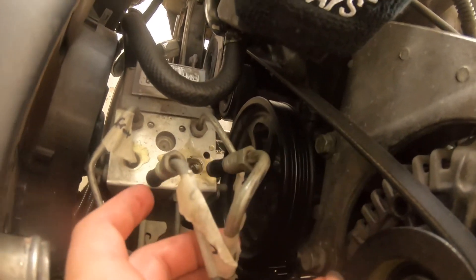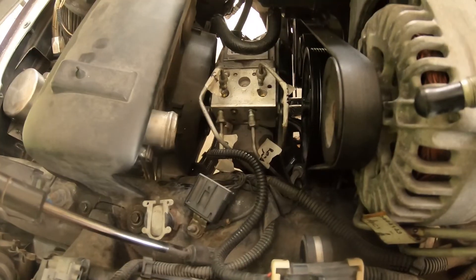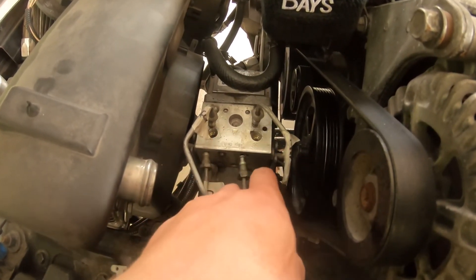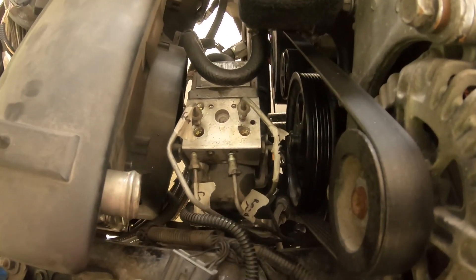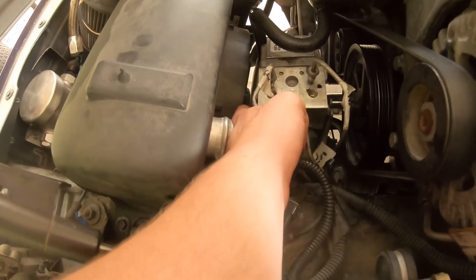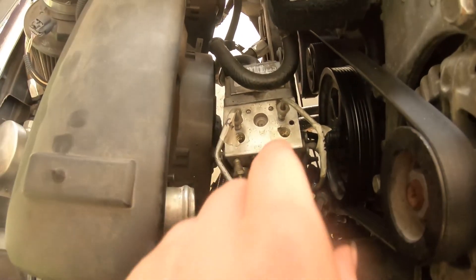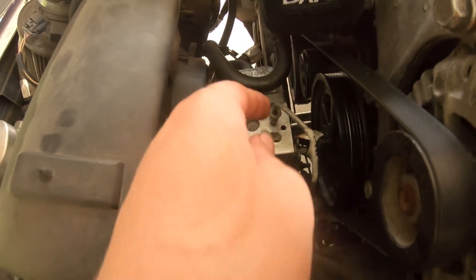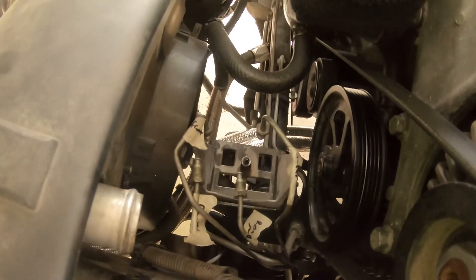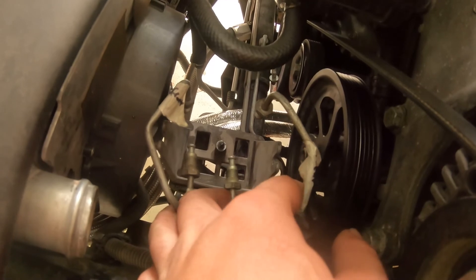I have the front and rear removed and have the vacuum caps pushed over so they won't leak. I'm going to continue removing the other lines off the ABS valve. With all lines removed, I'll unplug the pressure switch and the module, then remove the two 13mm nuts — one on either side of the valve — and then we can remove the valve and module and start installing the tees and bias valve.